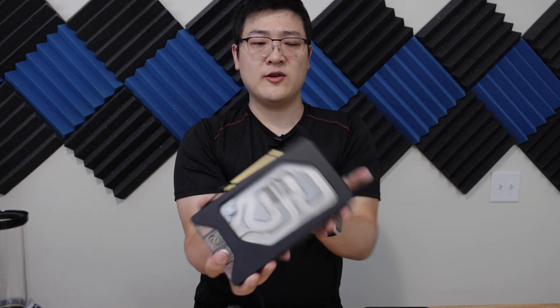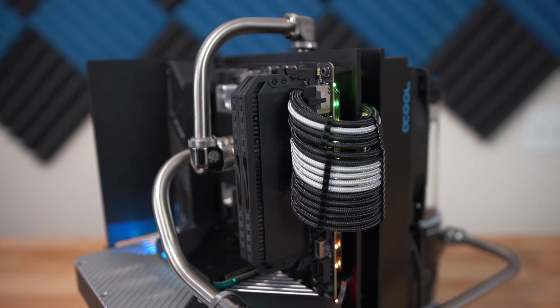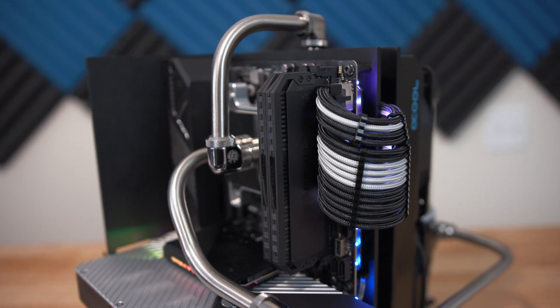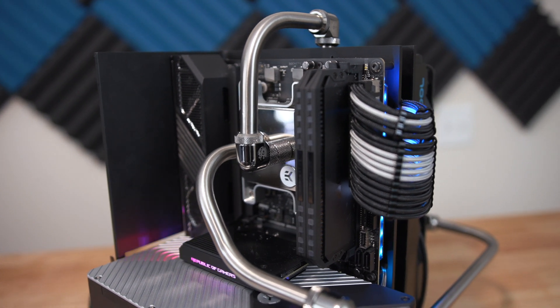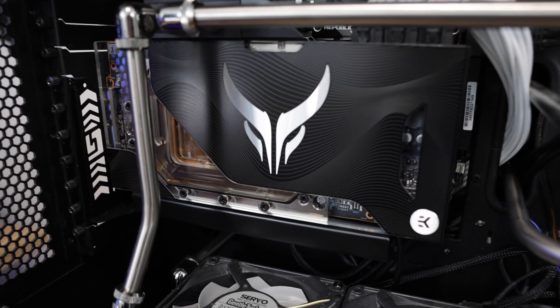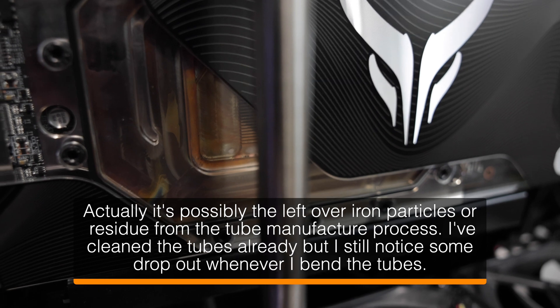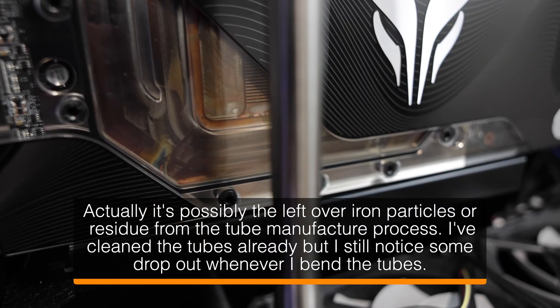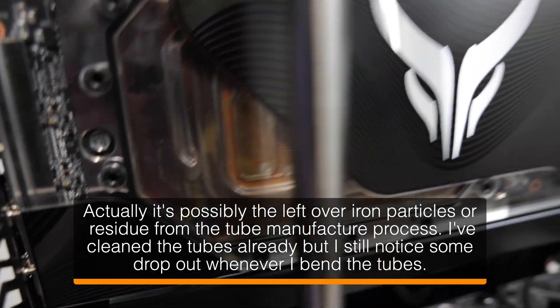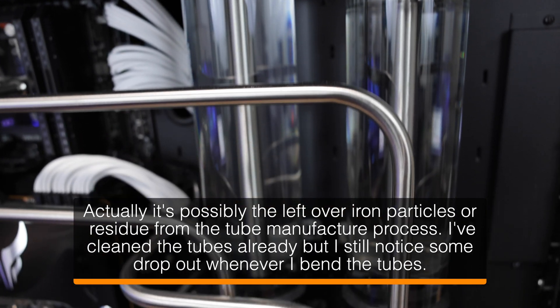I want to spend a moment and talk about why I think this happened. I've been using stainless steel tubing, and the stainless steel tubing with the copper should be all right. But ever since I swapped over to stainless steel tubing in this Mini-ITX build and my big desktop build, it seems like I've been having some corrosion issues. Maybe it's galvanic corrosion — I'm not entirely sure — because it seems to be only on the nickel. And I've had stainless steel tubes in my reservoir for years and haven't had any visible issues.